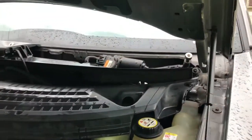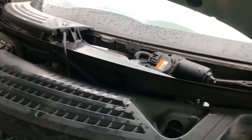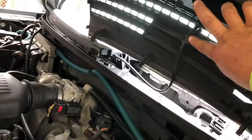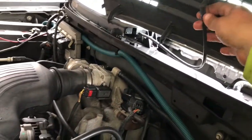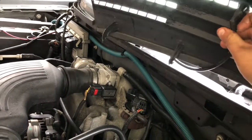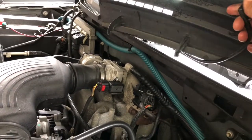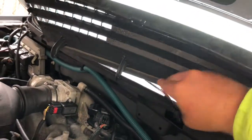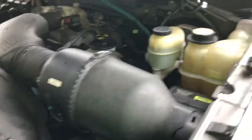One thing to note: you have to take the driver's side cowl off before you can get the passenger side off, because there is a bolt right there that comes off with this. Before you pull too hard, watch where your windshield washer fluid comes in right here - you have to pull that off. The ones I got actually came with new ones, so it came with a new plug. Once you pull that off, you're good, and this one comes completely out.